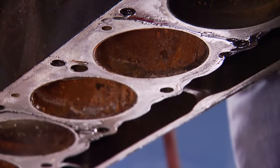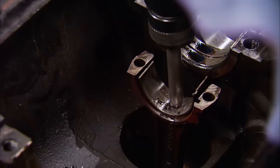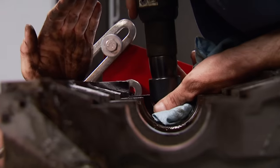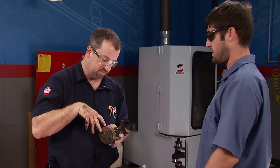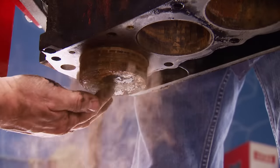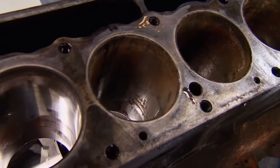We had to get more aggressive — before completely blasting the piston out with the chisel, we put a plate flat on the rod and hit straight down to jar it loose. The final two had the most corrosion and buildup on the cylinder wall. We have no idea how many miles this thing has — it could have a gajillion miles on it. By knocking the pistons out of the top, it gave us a cleaner and better view to check the condition of the cylinders. As far as we can tell, they may be salvageable.